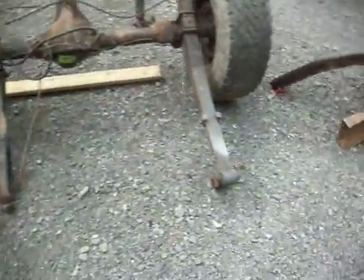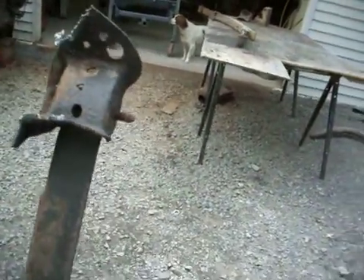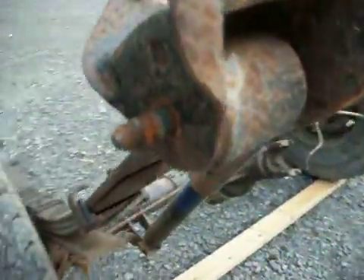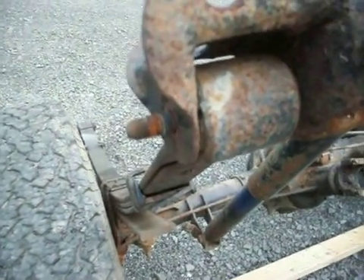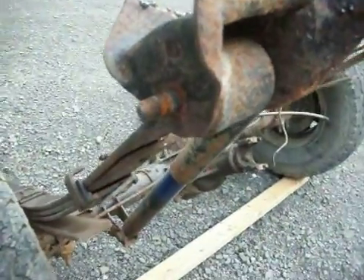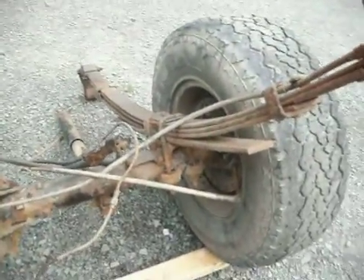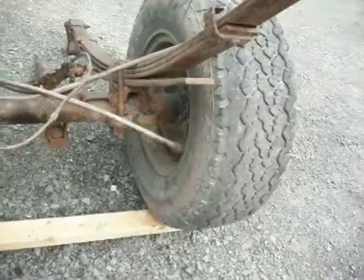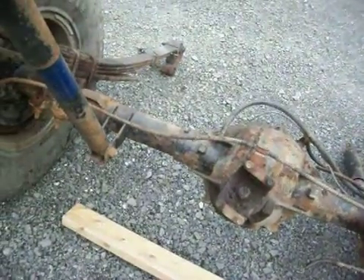You can see I also have the springs. I just cut these front spring mounts off with a torch because I made new ones. I just got to heat this up a little bit so I can get that bolt out of there, and I'd probably have to get new bushings for that. We also got some new springs, and I'm going to take this whole thing apart and buy new U-bolts, and change the fluid in the rear axle.